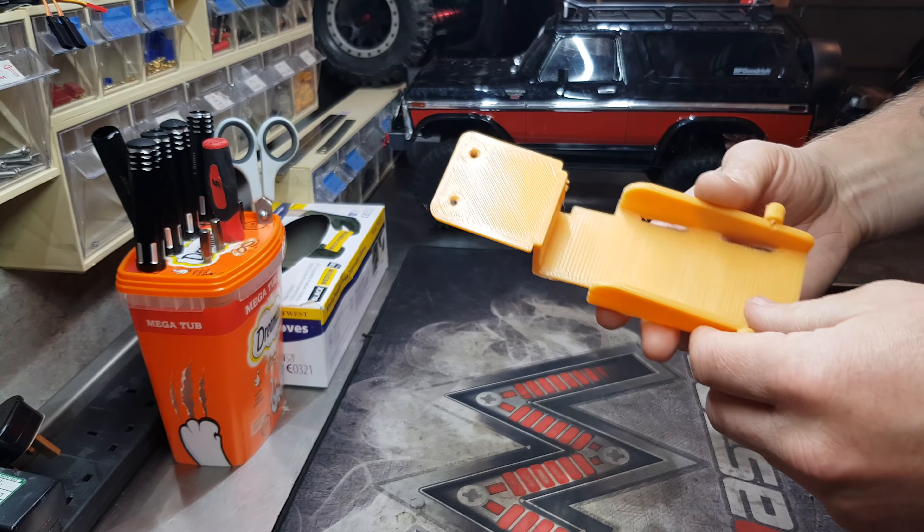It's got to get back down as well, because in the real world you might have to reverse back down without tipping up. We'll angle it up to 49, then go for 50. Once it's on there I'm leaving it go. 50 degrees seems to be about the maximum for the stock tray — it's pretty much going to tip back at 51.